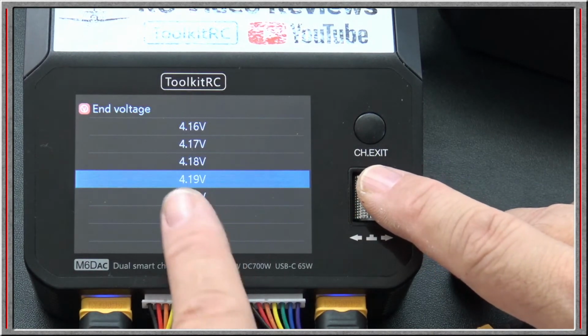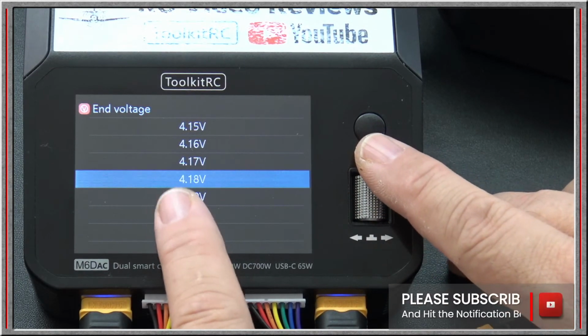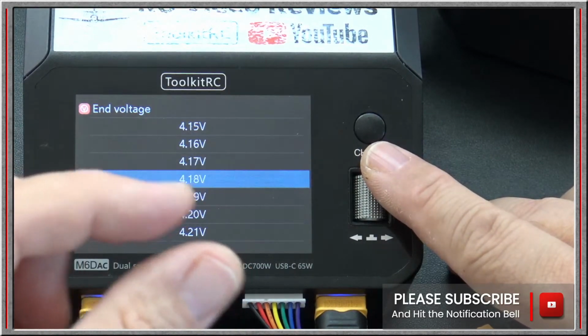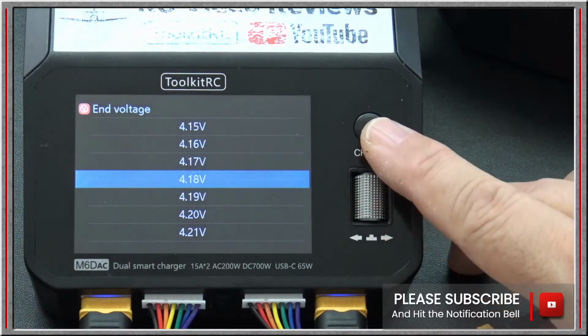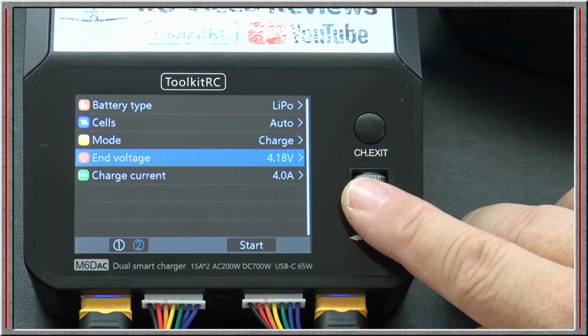And you guys know recently I've been lowering mine to 4.18 because that does a lot to extend the life of your batteries. So just by lowering it a little bit, yeah, you might lose a minute or two of flight time. But if you lower it just a little bit, you really help preserve the life of your batteries. It helps extend them by like 75%. It's something crazy like that.